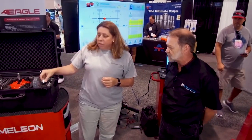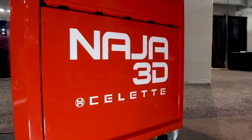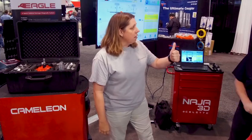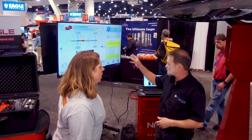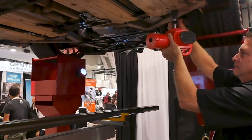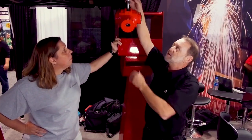This is driven off the NAUSIS database, which we've been using for the last year in our shop — simple and quick. To demonstrate: get the vehicle in the air on a two-post lift or any other lift, use the database to pick your target location, then tell the database where you've selected your laser location to hang. We now have our Eagle measuring system monitoring the vehicle, known in the database, so no leveling process is needed.